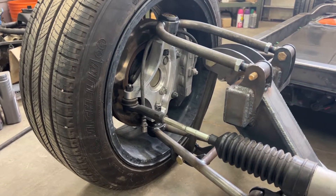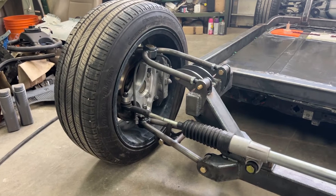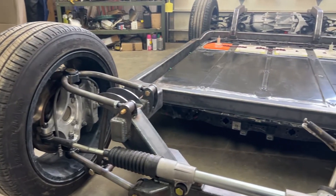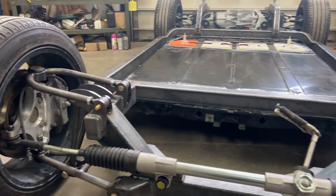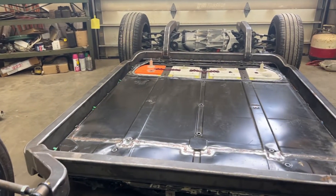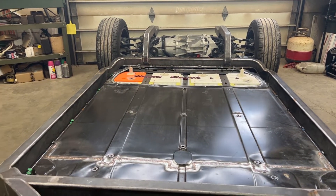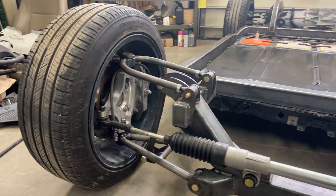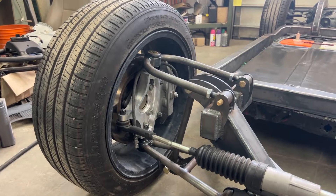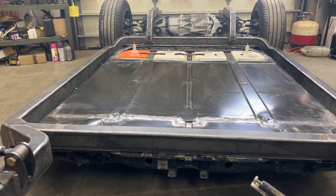This design gets rid of that McPherson strut, so it's designed for lower profile hoods. The Galaxy just had enough room to sneak the full strut in there, but this one has a relatively low profile front hood, so I needed something a little lower. The other cool thing it does is it keeps the same bolt pattern front to rear. For anybody doing Tesla swaps, this allows them to use the same bolt pattern, same offset, and sets the track width the same as the back — stock Tesla track width — so you can use stock Tesla rims, and it matches the brakes front to rear.